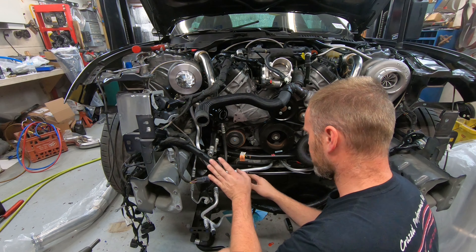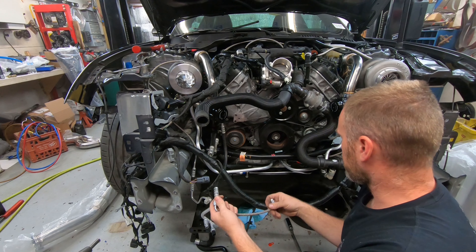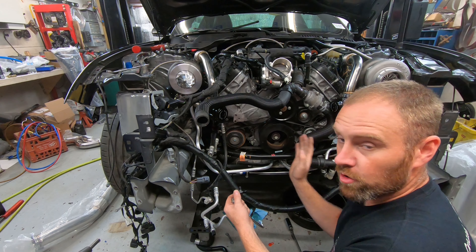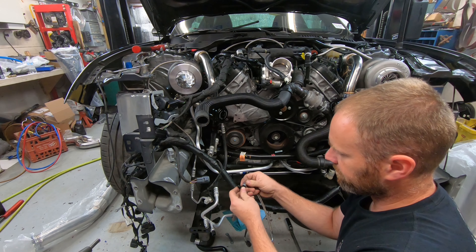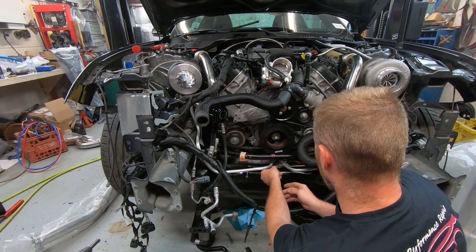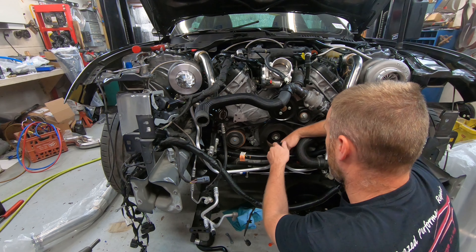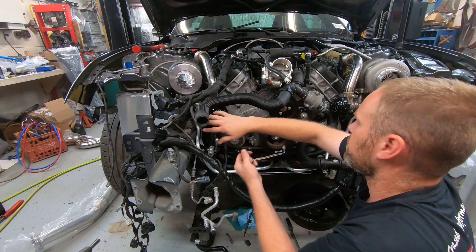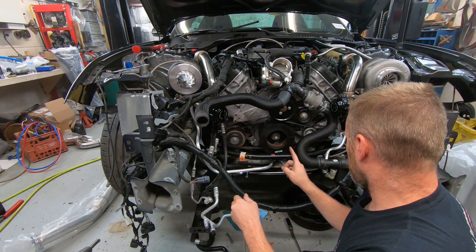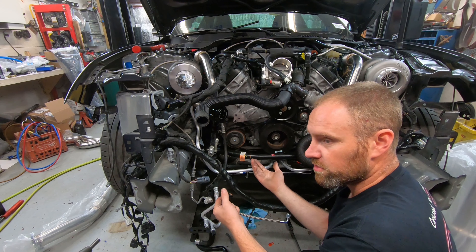I have the oiling system pretty much accomplished for the turbos. I still have to do the vacuum lines for the wastegates — that won't be a very big deal. The On3 kit comes with this little line, a T, and flexible dash-4 lines. They originally expect you to go from the oil filter adapter to the T with this line, and then have the lines go to each turbo. If I were to do that, it wouldn't be long enough — you'd have to bring the T up high and your lines would be stringing all up in the engine bay. I don't like that, so I decided to opt out of using that.